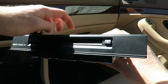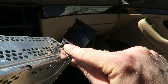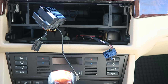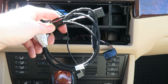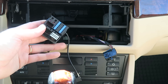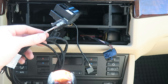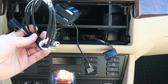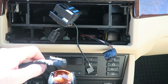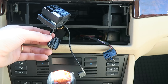Here is the new CD player going in. Now it's time to install our new cord — but as you can tell, we already have a cord here: a black plug that goes into the back of the main harness. Some cars aren't going to have this, and if your car does not have this, installation is super easy — you just plug this in. This is for your auxiliary cable; there's the port right here, you plug this in, put everything back together and you're done.